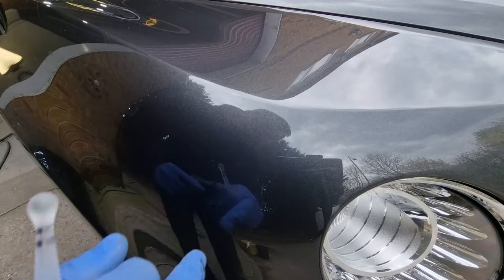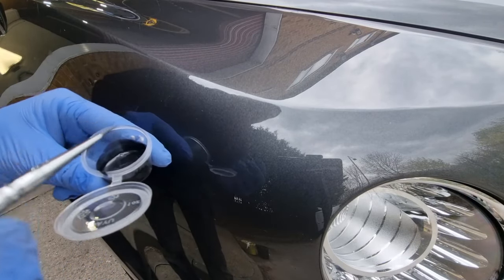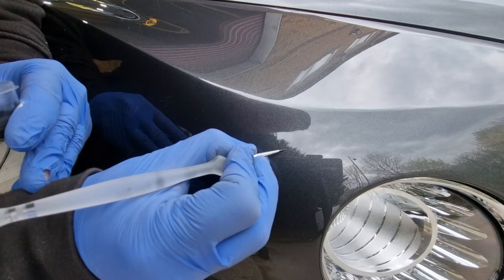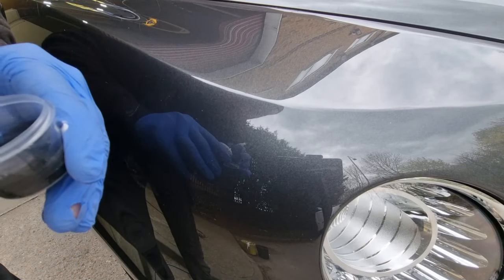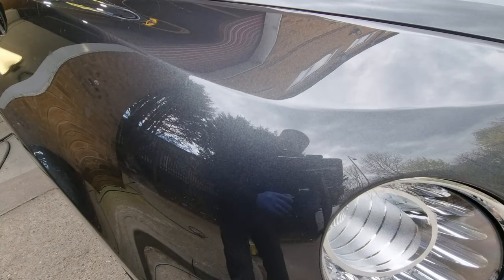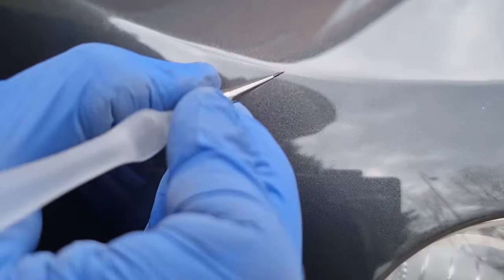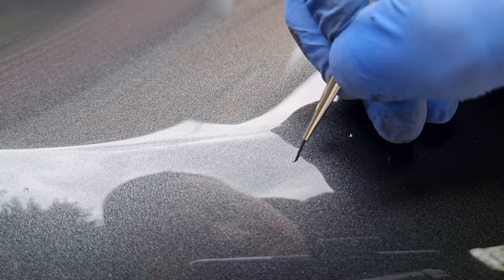Once that's done and we're happy with the finish, we're obviously going to be left in nearly all cases with some larger chips. I'm using some Paint Gear Products color-coded paint for this car, which you can order off their website — www.paintgear.co.uk, links in the description. We've rubbed all the polish off and buffed off the excess paint, and now we're just very neatly going around with a Paint Gear brush, filling in those larger chips so we're not left with any white marks which detract from the overall finish.